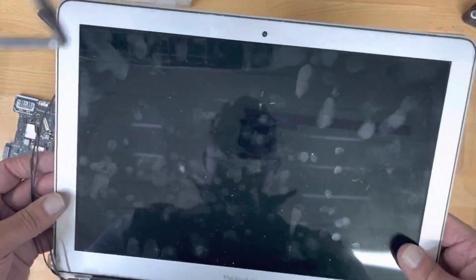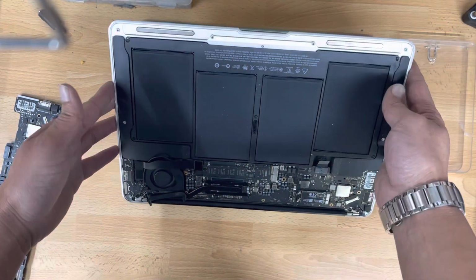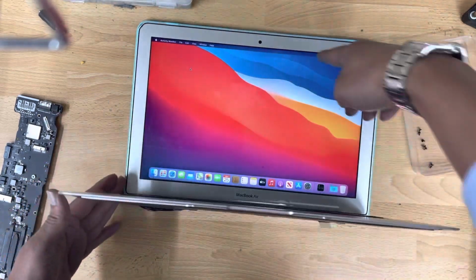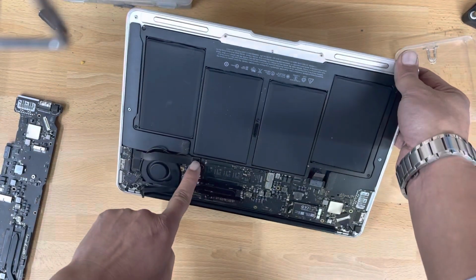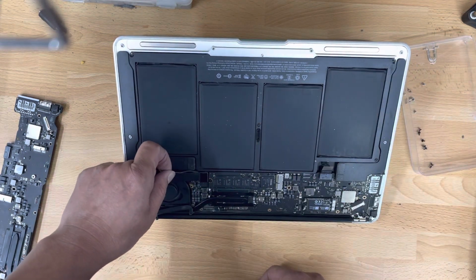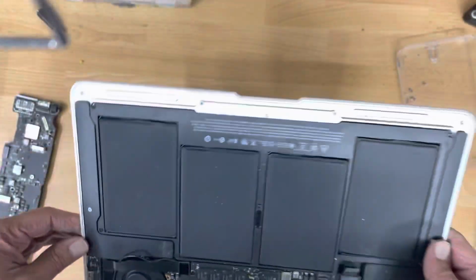The fan was at normal speed. Okay, this screen is a bit broken, but it works. Okay, now I found a solution. What is this problem? The problem is in the screen. The LCD brings the webcam and mic cable up to here. And if you disconnect the mic and LCD webcam, it works fine. That's a bit bizarre, but that works fine.